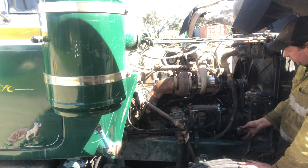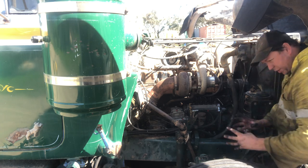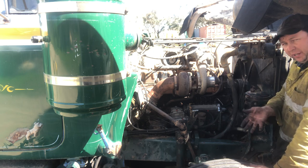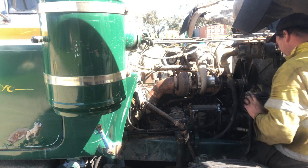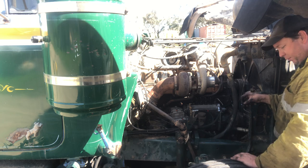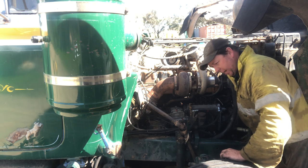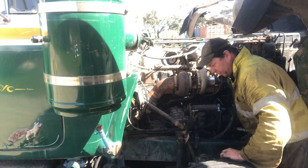If nothing really moves inside, the front coupler inside that housing, which is on the front of the pump, has got a keyway in it, so it can only go one way. So you don't have to spill time. I just put a different pump on this one, and I don't know where it was set up to before. Don't know much engine history at all, so I'm just starting from scratch that way. So don't think that you have to do this every time.